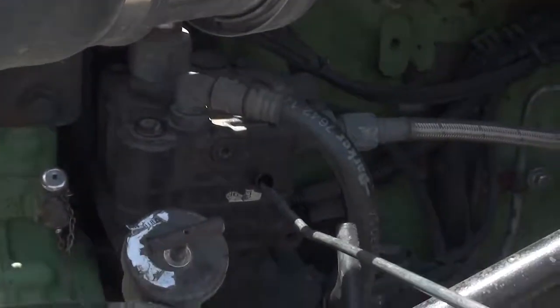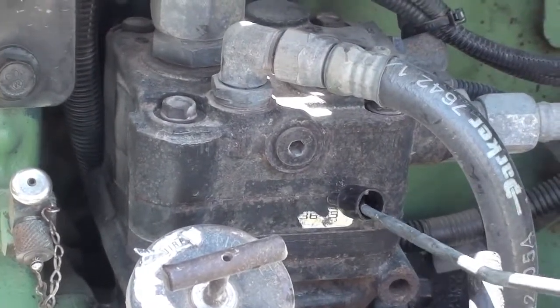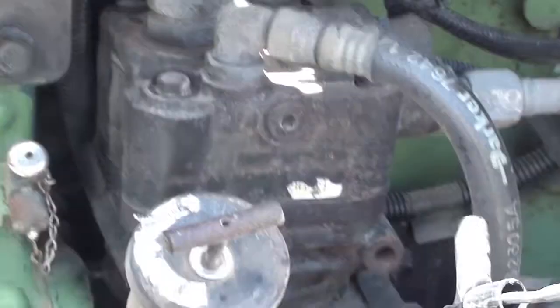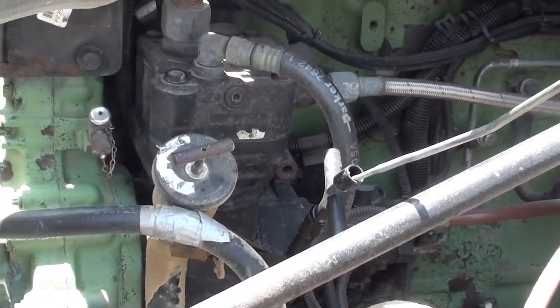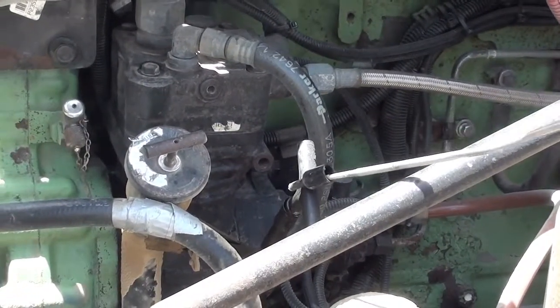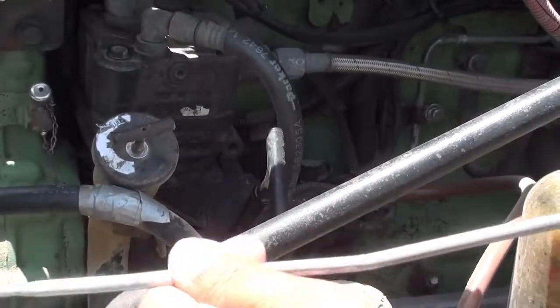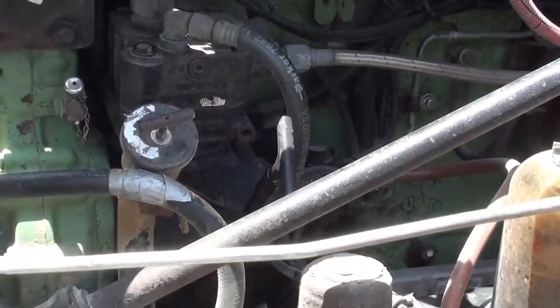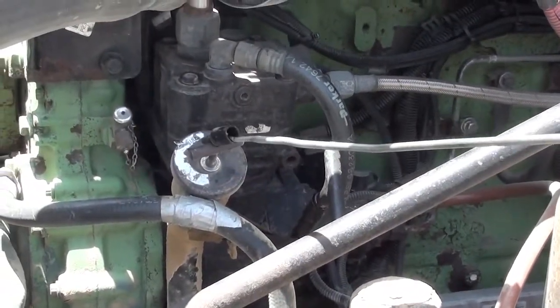We go to the air compressor. Properly mounted secure, not broke or damaged, no missing hardware, no leaks. This is also gear driven. Oil dipstick. Properly mounted secure, not broke or damaged, no missing hardware, no leaks. This is where I would check the oil level. How would I check the oil level? I would take the stick out, clean it, put it back in, pull it out again. In case I need oil level, I would put it in the oil reserve, cap tight.